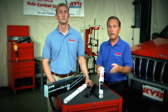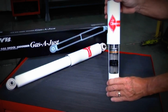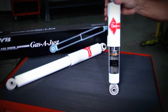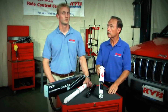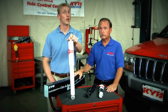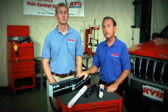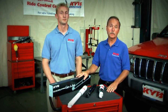It's all kept in the upper cylinder so that the valving can respond faster. In place of a fluid reservoir, there's an additional nitrogen gas high pressure chamber in the lower section. On light vehicle movement, the gas pressure cushions the ride, and when you need performance and there's more aggressive vehicle movement, the now compressed gas pressure expands and adds vehicle control. So when you install the Gas Adjust as an upgrade, you get quicker, more responsive handling and control, along with a more stable ride than what the vehicle had originally. Or when you install the KYB Gas Adjust on a vehicle that came from the factory with a monotube design, you restore or keep that vehicle's original performance characteristics.